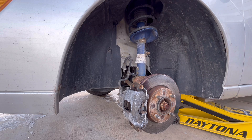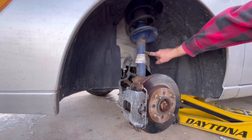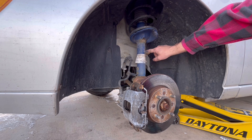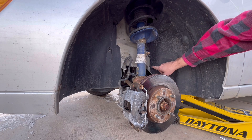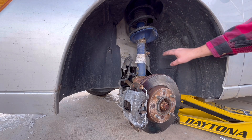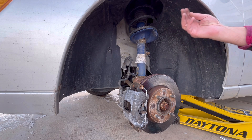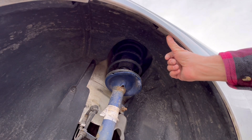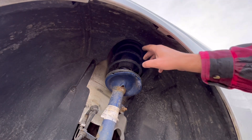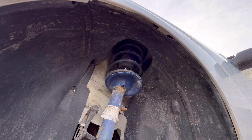There's a bolt down here, so you're going to need an eight-millimeter socket. There are two pins right here and you should be able to get them out with a Phillips screwdriver, but they're stripped out. I can't get those out without busting them, so instead of replacing them I just have to manhandle this thing. The hardest part is this little metal tab right here — it goes into a plastic pocket. Get that popped out, just pull this back a little bit, enough to work with that reservoir.